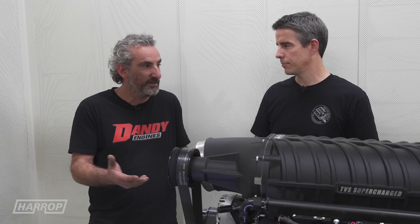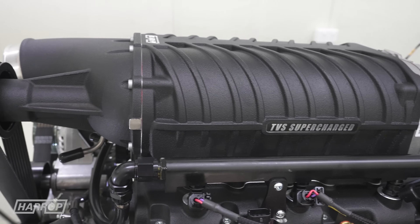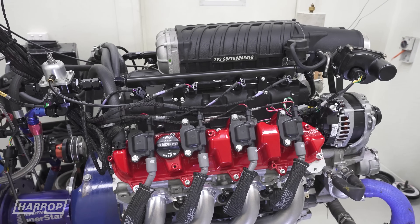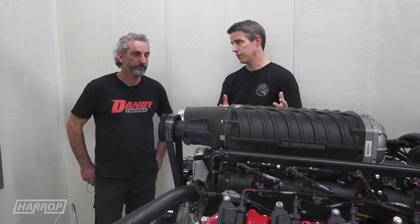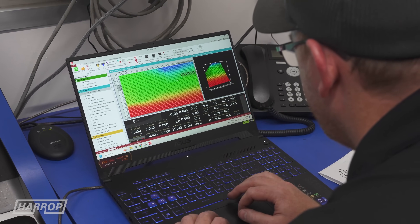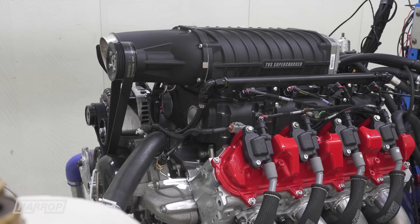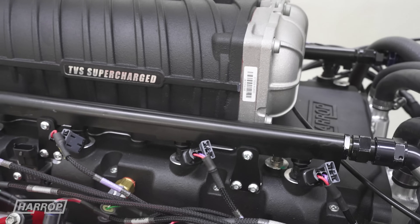Pistons and rods is a must if you're going to lean on it. Our new supercharger — which we're here to talk about — is a top mount design. It's using our Mark II housing, but importantly it's got the fuel rails integrated, so we're running this like an LS engine. The DI ports have been blocked off. We've got Fuel Tech; big thanks to NADS for supporting on the engine control. To make the lower intake manifold more adaptable, we've got it drilled for both the intake manifold hole positions for LT1 and LT4 heads.